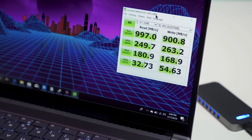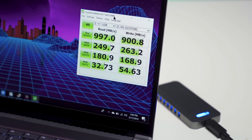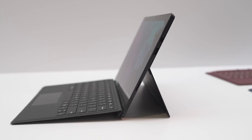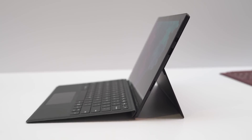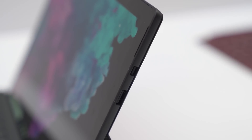Should also mention that this requires USB 3.1. A lot of laptops only have 3.0, so consult your manufacturer before you purchase this. Devices like the Surface Pro 6, believe it or not, only have a USB 3.0 port and therefore can't handle all the data that this drive puts out.